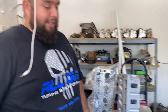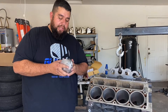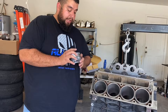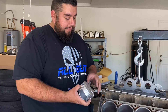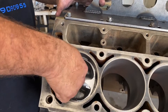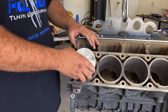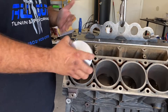For the pistons, this is an aftermarket piston — not OEM — but it is a 6.2 piston I bought for the customer. The standard bore is 4.065 inches, and you can see it goes right in and comes right out. So like I said, it's now a 6.2. I'm going to be running these pistons with new rings.